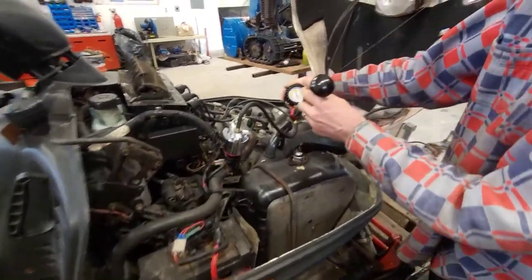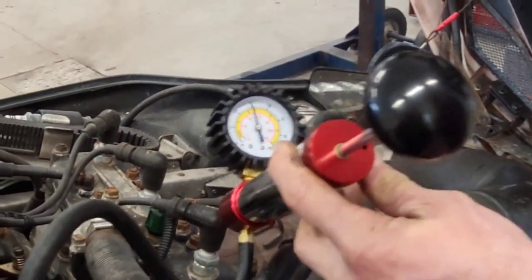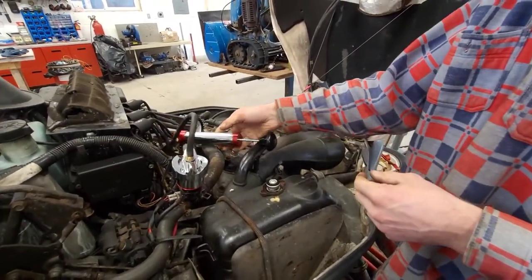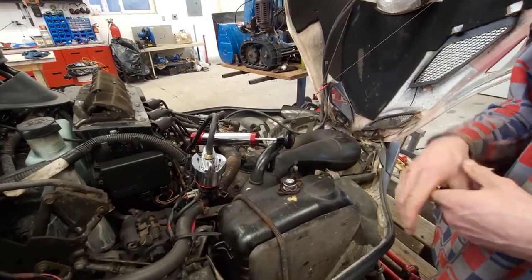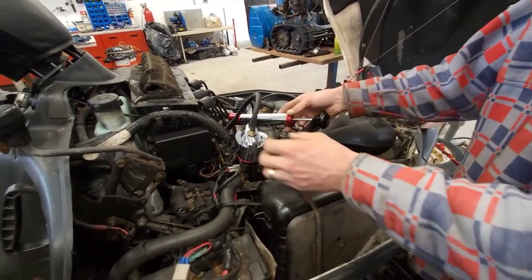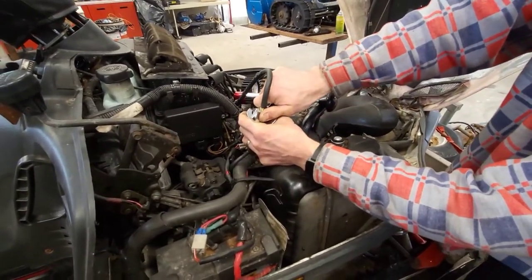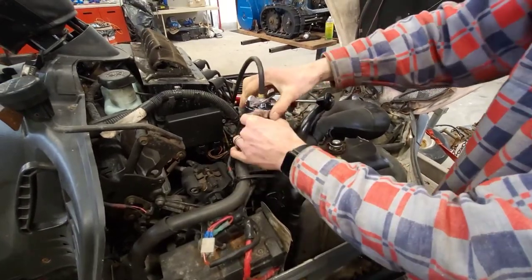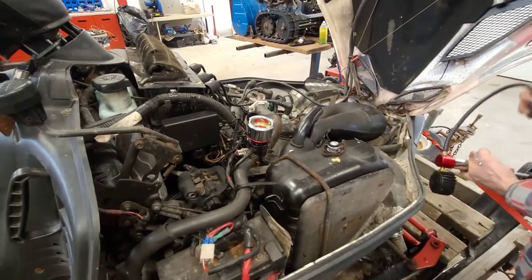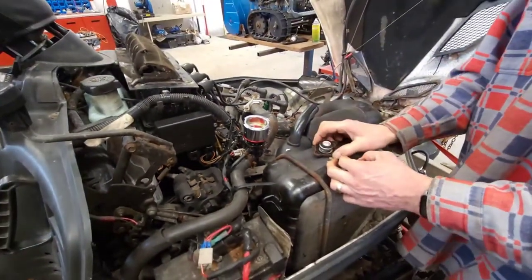Okay, so it's been about 15 minutes now and we only lost about half a pound — I'm going to say that's good. Why did I lose a liter of coolant? Probably because I had an air pocket in the system that finally made its way out after sitting this summer. So let's take this cooling tester off the machine, we're going to bleed the air — remove that off there. Once we remove this, we'll put the cap back on.